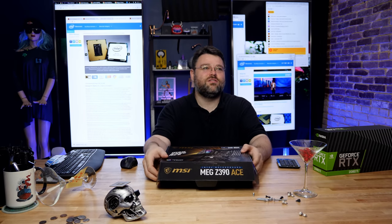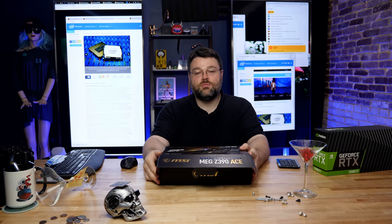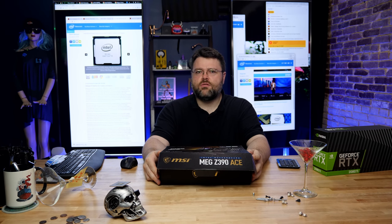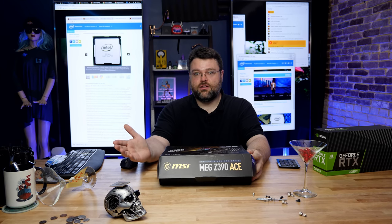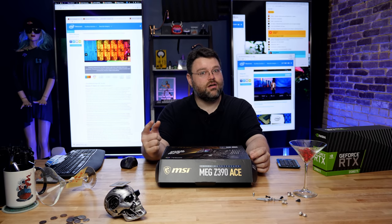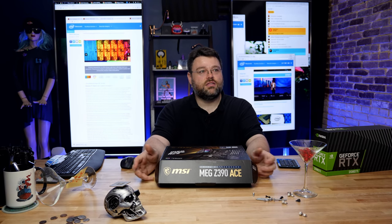Want to buy 3200 of 2x16 gigs of ECC RAM. So you can build it yourself. Samsung has, is it 3200? I think it's 2933. Samsung has 2933 chips from the factory. They're making chips that are 2933. You can solder your own RAM on the reference PCB, but it's not being mass produced.